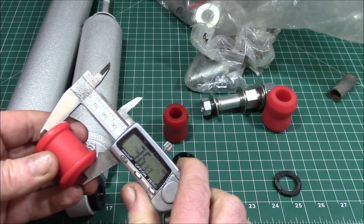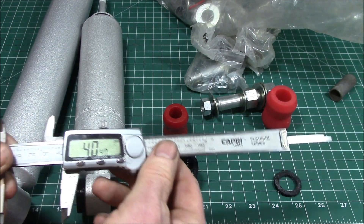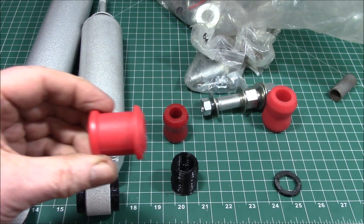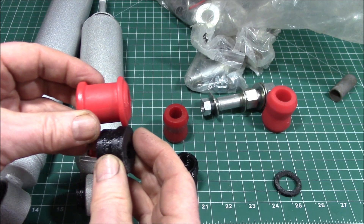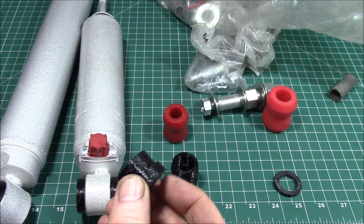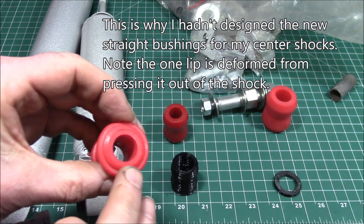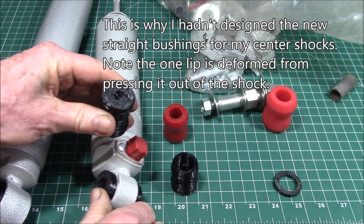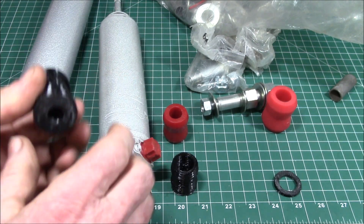This one was around 36 millimeters and this one's about 40 millimeters, so this one was pretty easy. What I did was model this L1 straight bushing but made it into a split bushing — two halves instead of one solid piece — because these bushings you end up almost destroying them if you try to remove them.